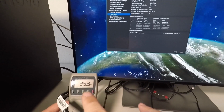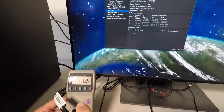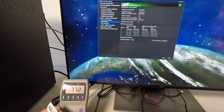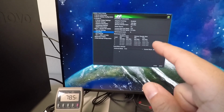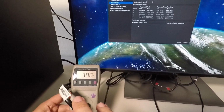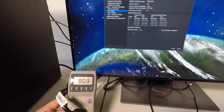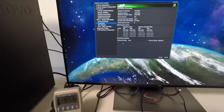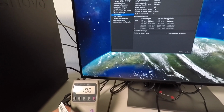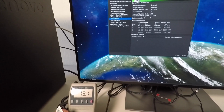It's really the power consumption that we saw earlier, the higher power consumption was really due to the video card driver. And so once we switched over to the Nvidia driver, we're seeing idle power comparable to what we saw in Windows last time. So okay, that's something I just learned. I didn't realize that was what was causing the higher idle power.